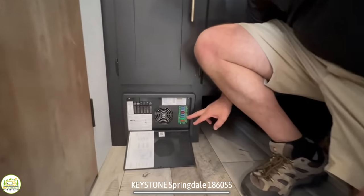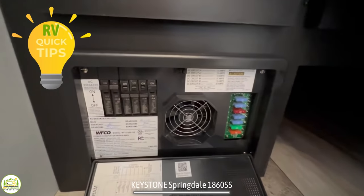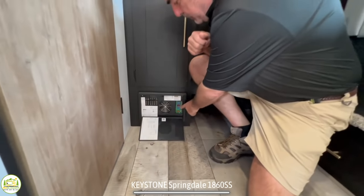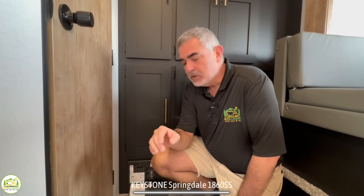One question we get asked in our Facebook group and on YouTube is: are the fuses you use in an RV the same ones as in your car? The answer is absolutely yes. I recommend you visit AutoZone or any auto parts store, buy a multi-pack of fuses, and keep them on board. If anything blows, just replace the fuse with the same exact number on it — it's going to be 10, 15, 20, or 30. That way if you're out on the road and have to replace a fuse, you're covered.